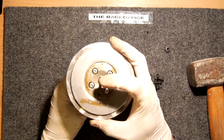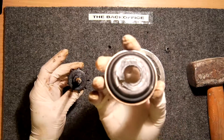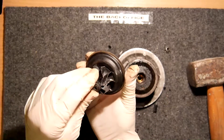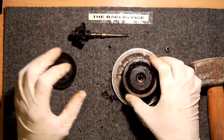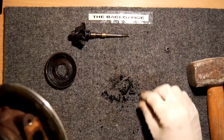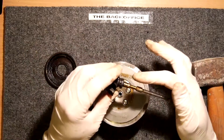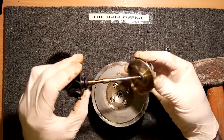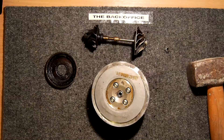Let's have a look. So that slides out. There's clearly a load of filthy crap in here, and it appears to have a seriously big chunk kind of taken out of it. That's damage caused by the wear on the impeller, just crunching it from underneath. There's a lot of crunchy crap here. I don't know if this is part of a seal or if this is just carbon build up — I'm suspecting it's carbon build up. Just some grooves on the shaft. Something I noticed on this impeller — this is how they balance them, they must wear a chunk out. So really you've got to be careful. I don't think it's worth trying to rebuild this part at home unless you've got some way of balancing that.